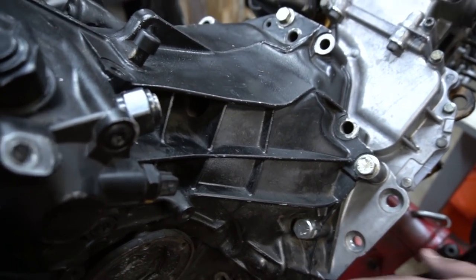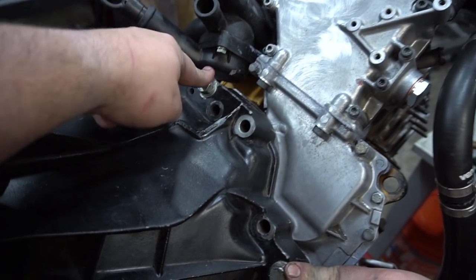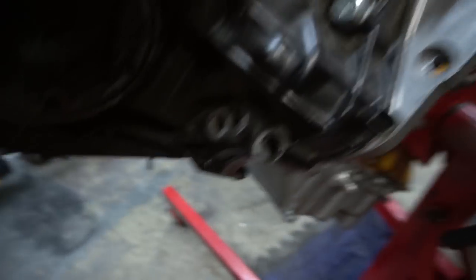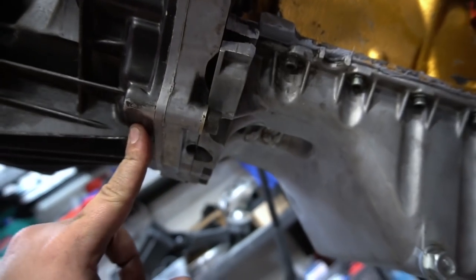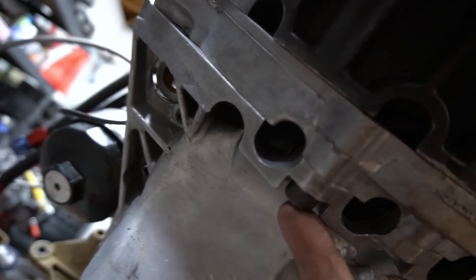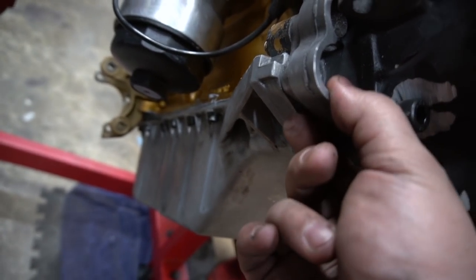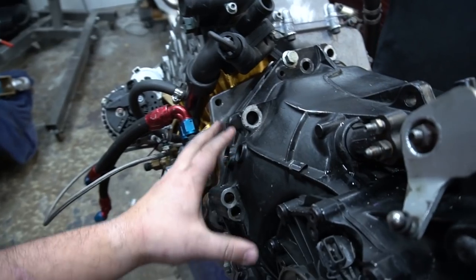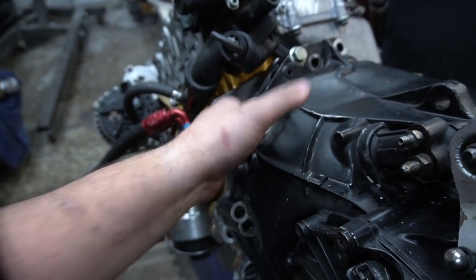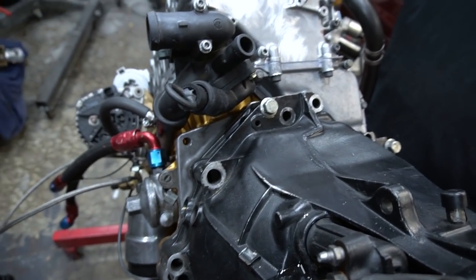Let's show all the bolts we use, since a lot of people asked about the VR6 swap. From the trans to the adapter plate slash bell housing: we have the 12 o'clock, roughly 2:30, the three o'clock, and then the lower transmission bolt here that goes from the adapter plate to the back of the bell housing. From the back of the oil pan to the adapter plate is another bolt at roughly the six o'clock. Then at the seven o'clock there's a small bolt that secures to the adapter plate and helps close the gap. On the driver's side you're really stuck — there's really only one bolt — so we double our efforts at the 12 o'clock and every other position.